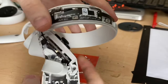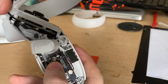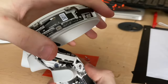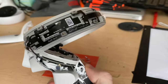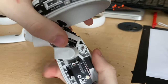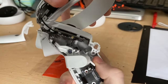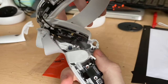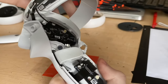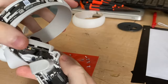Keep in mind this panel is connected with a ribbon cable. I actually chipped off a piece of plastic trying to remove it, so be careful. To remove this ring, push the whole assembly slightly — nudge it in this direction — and as you nudge it, pull away from the area that the ring is slotted in. It should slide right out with a bit of shimmying. Do this very carefully because the board is connected via a ribbon cable — you don't want to pull or yank on it hard, otherwise you could rip out that cable and mess up your controller. Do this at your own risk.